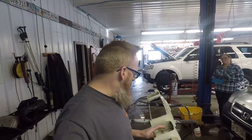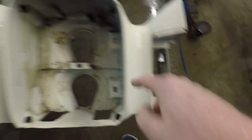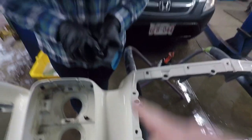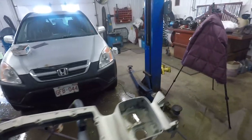Now that we've got it all washed down, I took the air hose and cleaned all the grime off and tried to dry it up a little bit. We're just going to scuff it up by hand in all the nooks and crannies because there are so many curves in this area, and we'll use the DA on all the flat surfaces. My wife is going to start using the hand block to sand through the curves and I'll grab the DA and we'll get to work on all the flat spots.